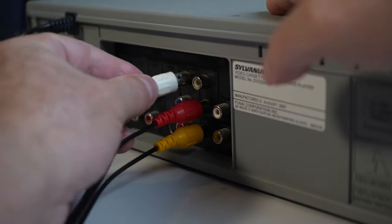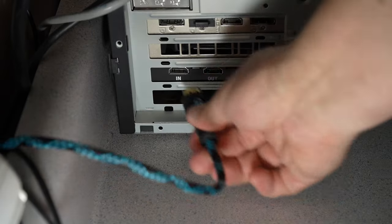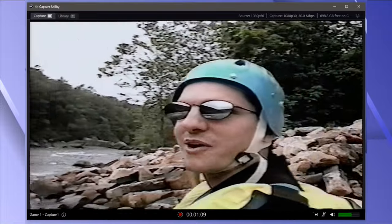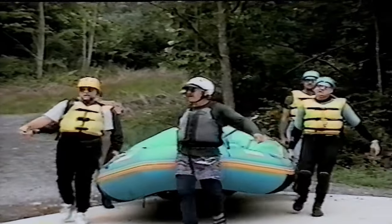So you'll need an external device instead. To make this work, plug the audio and video cables into the back of the VCR, then plug them into the upscaler device — make sure your upscaler has power. From here, use the HDMI cable out of the upscaler going to the capture card device you are using. I'm using the Elgato HD60 Pro, which supports 1080p 60 frames per second capture. Install the Elgato 4K capture software and run it, and you should see the video on your screen. Press play on the bottom of the screen and play on your VCR. Just like before, we just need to watch the wonderful memories, and once it's finished, press the red button again to stop the recording. Our final video is a true 1080p high-resolution video file, and I think the video quality looks amazing.